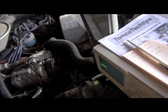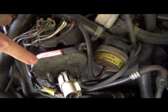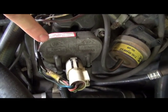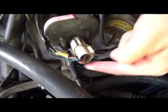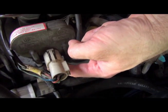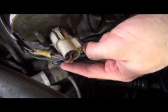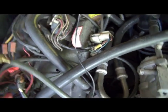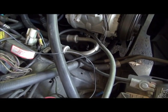In order to run the self-test, you have to connect a vacuum hose to the atmosphere side. Let me turn the camera around — this is the BMAP sensor, the barometric manifold absolute pressure sensor of the car. This hose down here, this fitting, is usually open to atmosphere. You have to hook up a vacuum pump to this line. You do not touch the other line, which goes to the intake manifold and measures manifold vacuum. You only want it on the atmosphere side. So I have hooked up a hand vacuum pump to the atmosphere side of the BMAP sensor. That's part one.